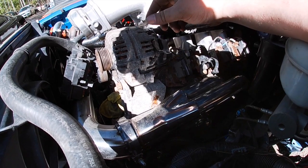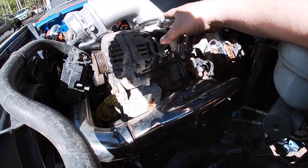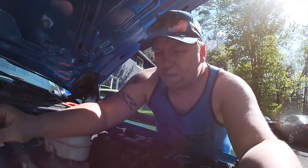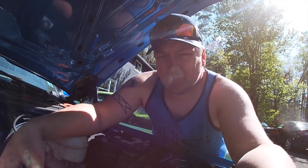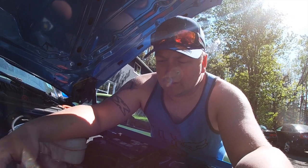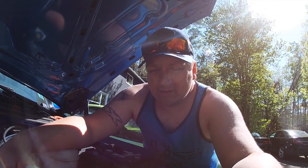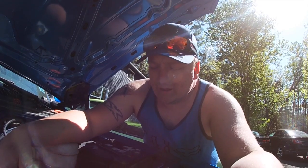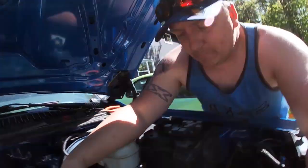We're going to pull the turbo kit off, we've got to pull the heads off, intake manifold off, we've got to put the new water pump on, and then this week we'll put the new head gaskets in, heads on. Well, we're just planing the heads, but we'll put the new head gaskets on, the new head studs. We got LS9 head studs, and then we can put the intake manifold on for good, and then we can finish up the wiring.